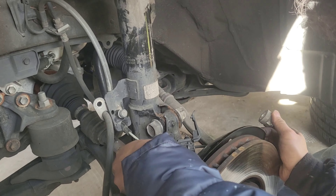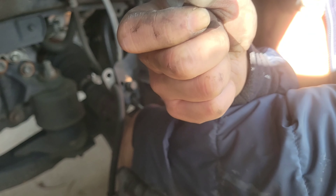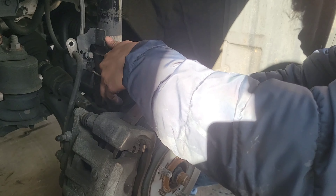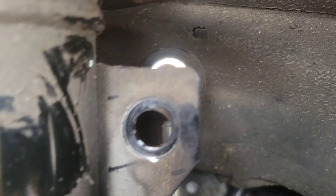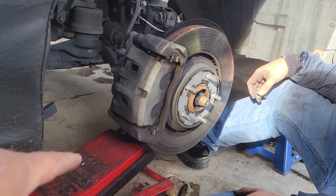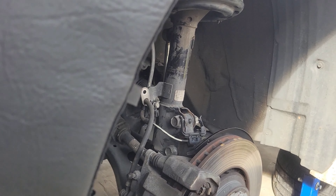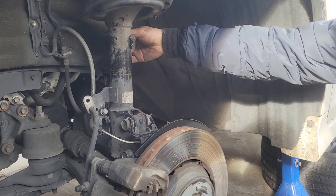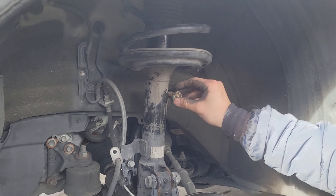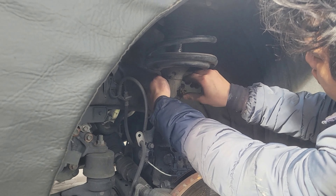What we're doing here is also aligning this so that the two bolts will go in. You see the bracket here? This is the stabilizer bar end link. We're going to pump up the jack to make the hole move up to the end of that link, and my son's going to call it when it's good. That's that, guys — it's pretty easy. The other side is the same. It's a pretty easy job, but sometimes it requires two people.